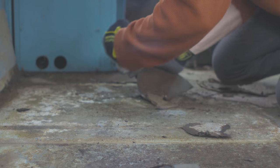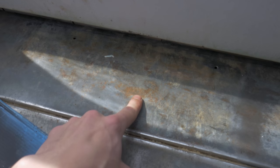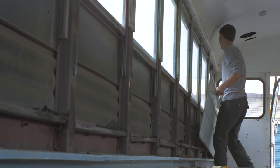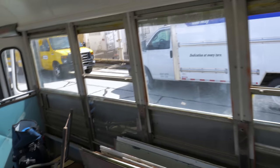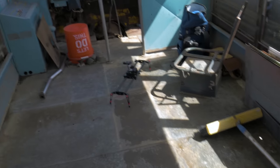So far what we've done is we've ripped out all the old carpet. Right now it's just a bunch of glue stuff on it that is taking much time to remove. We've been using angle grinders and a wire wheel to get it all out. As you can see over here, which is looking a lot better — it's not even rusted. This bus is 60 years old or so. There's some spots with a little bit of rust, but everything's looking really good. We've ripped out some of the walls. We're going to be insulating these — we need to rip out the roof so we can insulate it. Right now it's basically just the flooring. We're going to build probably an inch and a half of insulation along the floor, throw some vinyl flooring on it.